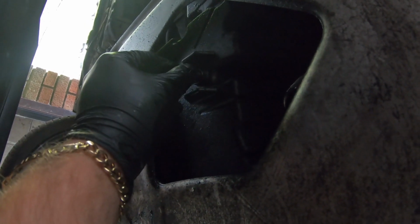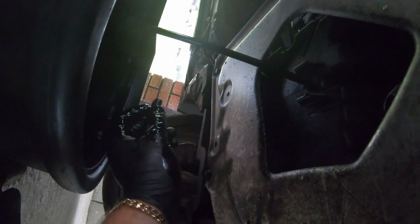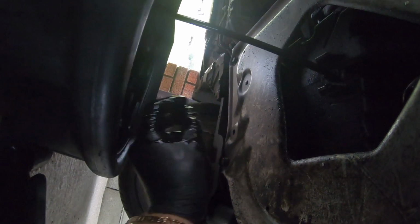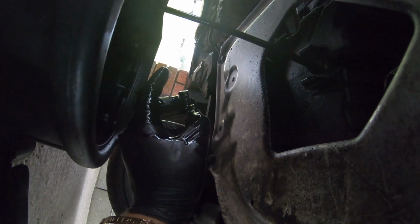So now we're going to bring the drain down right here because it leads straight down, and we're just going to pull the sump plug. As you'll see, just going to release it and let it drain straight down into the pan, which I've got right here. Now, as you'll see, it just drops straight out. Make sure you catch your sump bolt unless you've got a new one ready to go in the washer. If you ain't, my best advice is keep your drain plug. You don't want to be losing it under the oil because it'll be a mess to get it back out.